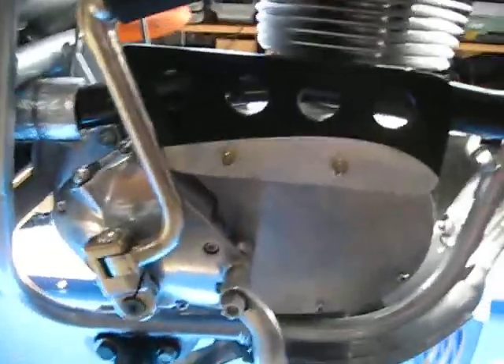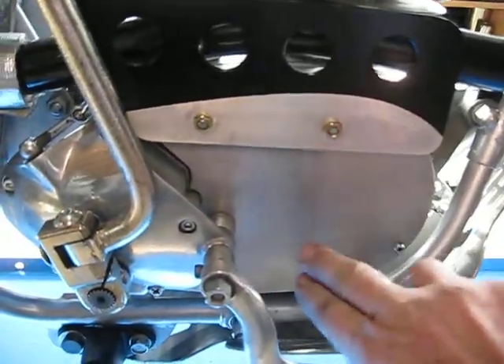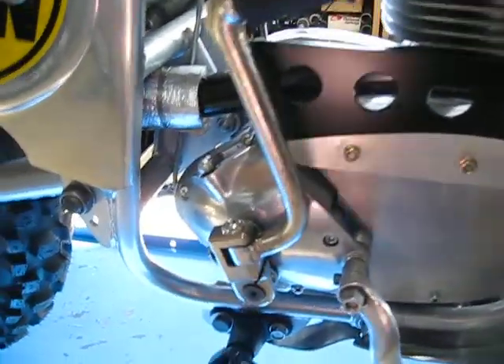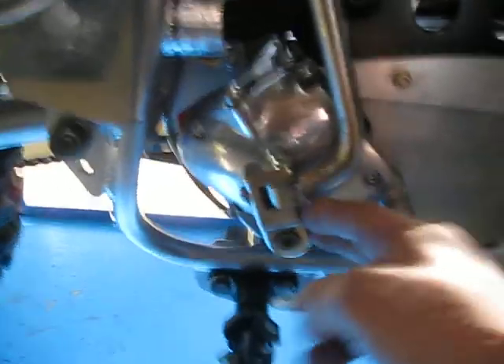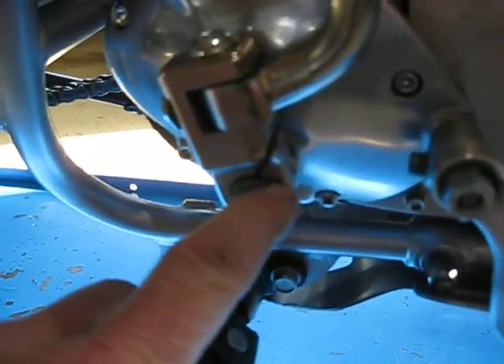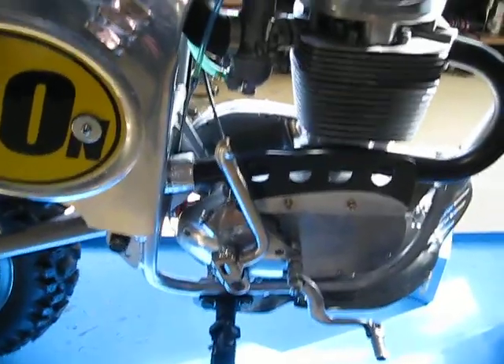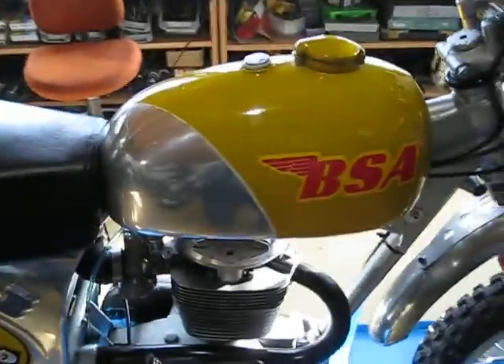On the right side of the motor, because you are removing the point system and all that, a common modification was to cut this side cover back and put a flat plate on there. I did that and I added a heat guard on the top of that. This kickstarter kit is kind of nice. I won't get into the specifics of installing it but they make it harder than it needs to be. It's not an inexpensive kit, but if you can see the splines on there versus the old cotter pin system — you can adjust where your kicker sits and the range of your kick much, much better than you can with the old-style stock ones.